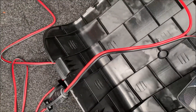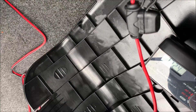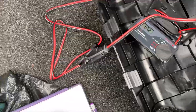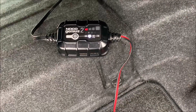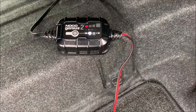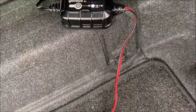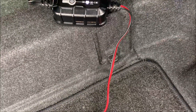It's been about 20 minutes. The voltage is now 12.24 — a little bit higher than when we started. No change on the unit itself — the first red light is still kind of pulsing, coming on and going off. According to the book, that means it's still not quite 25% charged. It's only been 20 minutes, so we'll just leave it.